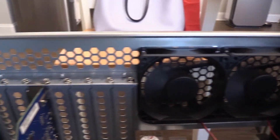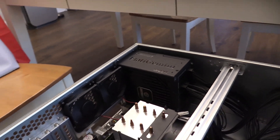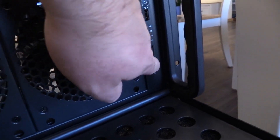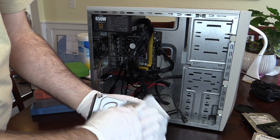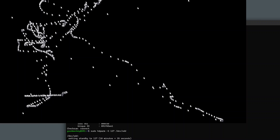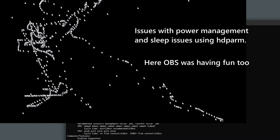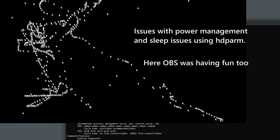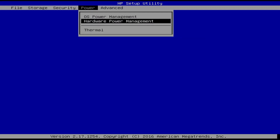Both machines make more noise than I'd like. I think I'm becoming a snob when it comes to that now. Things get quieter if I can get the hard drives to spin down. There is conflicting information on if this helps or hinders drive longevity, but I've had the 13-year-old 3TB drives going to standby after 10 minutes since they were brand new and they are still running fine. So far though, I'm having issues with any drive parameters issued with hdparm from taking effect in SR1. I don't know if this is something with the motherboard or if something else weird is going on.